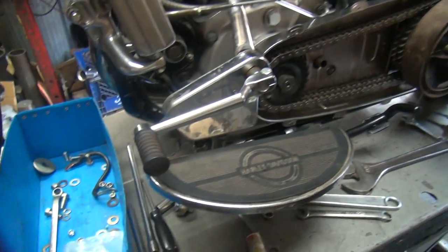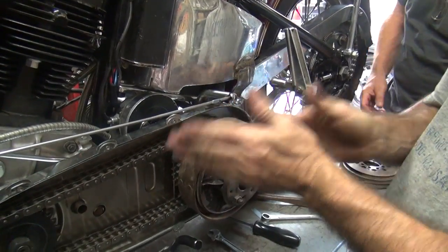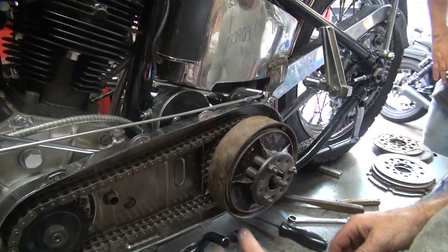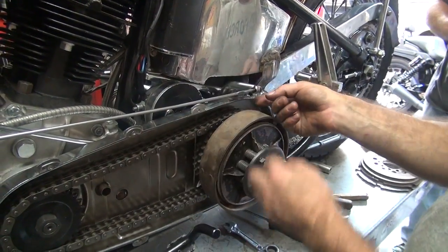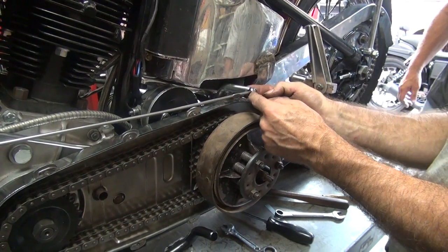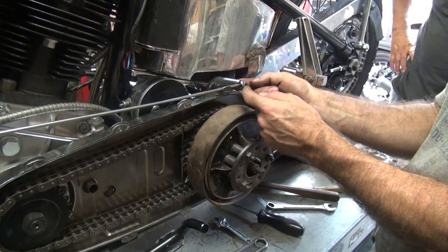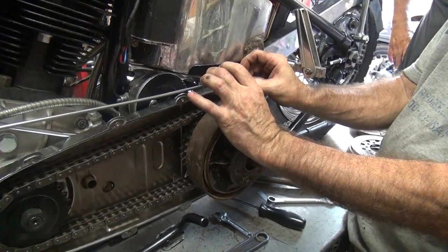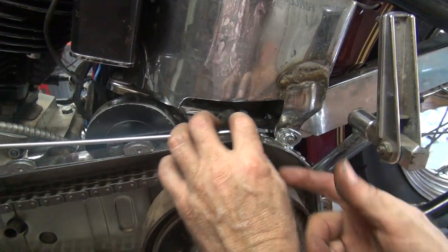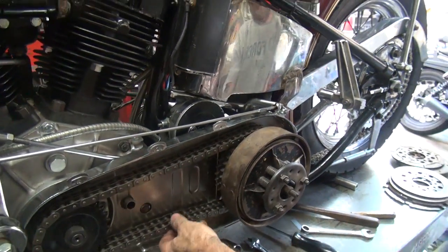See, I got a finger between me and the handlebar. That's where the clutch just releases. See, it locks right there. So I got all this room here. So this thing's going to let out about halfway out on your lever. About halfway out is where your sweet spot will be. That's where I like it to be — half to three-quarter out. You can fine tune that with your cable here. By changing this free play, it changes where this comes in at. You adjust the two things to get this to let out where you want it to be.